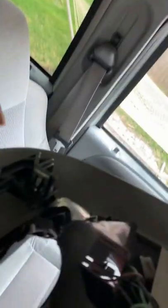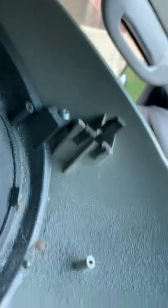Now I'm going to show you where the tabs are so that you see how it's connected. Up here you see a little slot there - that's where this tab fits into. This is a standard kind of a body panel tab, metal tab that you see all over automotive. In the front, there's two of them. And they just snap into those plastic slots.